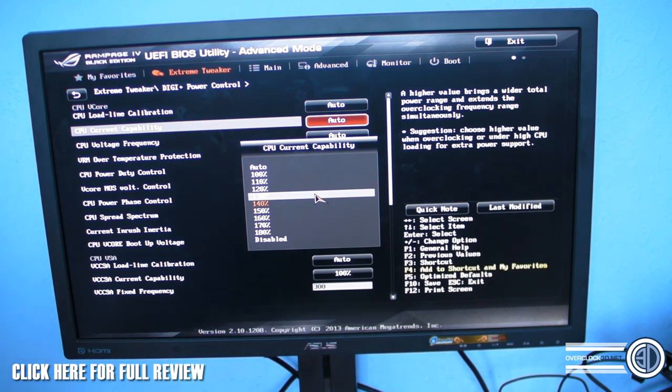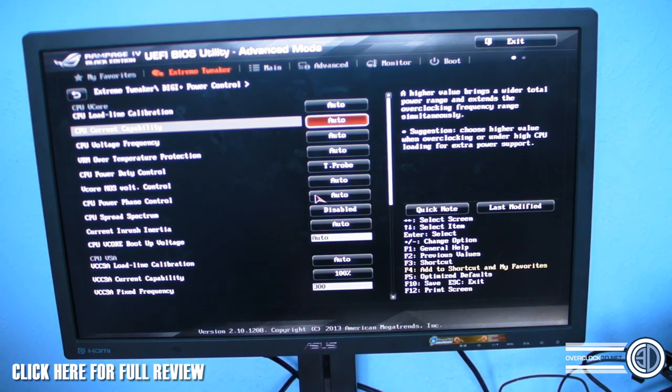if you do buy this board, the reason I say do things in stages is because if you boot up and your system's stable and you know it's stable, then you change one thing in the BIOS, whether it's this or something else, and then suddenly it's unstable, you realise you've got a problem. So it's just that classic thing that I always tell people: when you're starting afresh, do it in stages. Obviously, I've been used to not having to do things in stages because I've been using the boards for so long. But if you buy a new board, please start up and do it in stages.